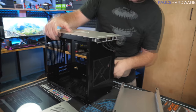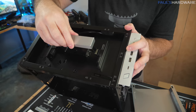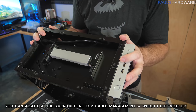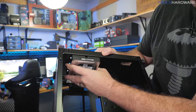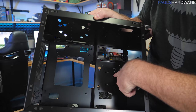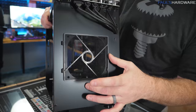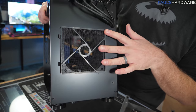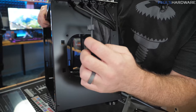The top piece also pops off, which is convenient and gives a look at that handle — very well done, securely mounted to the steel frame inside the chassis. There are additional drive mounts at the top with grommet holes for 2.5-inch or 3.5-inch drives. The mount at the rear back is actually for a 2.5-inch drive with screw extensions included. The front intake area has a dust filter for that front 120mm fan mount, though I have some concerns about airflow since the front is mostly blocked except for that intake.